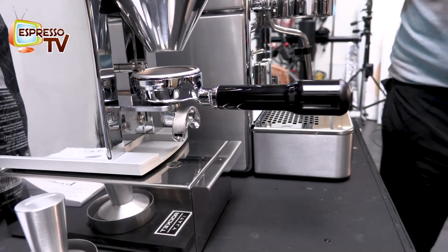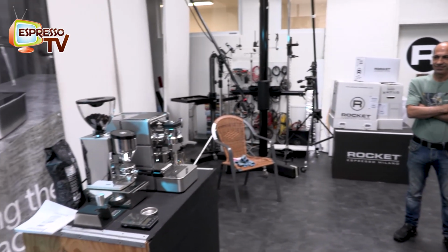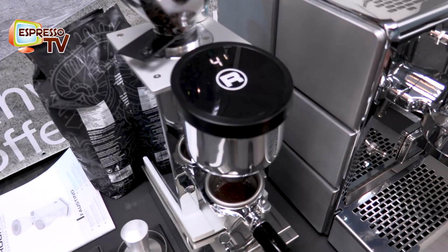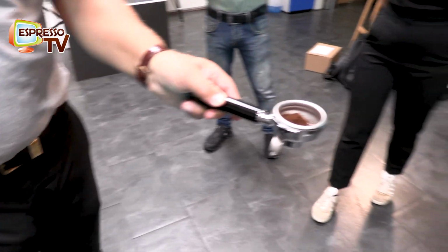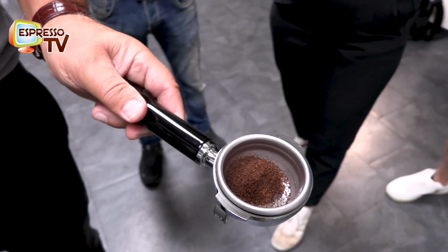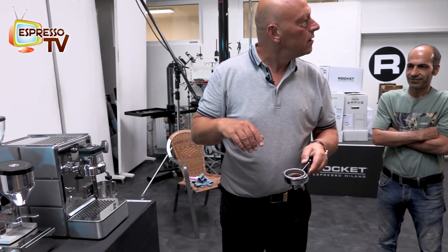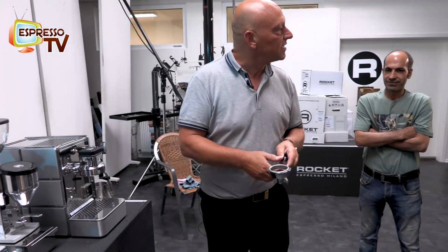But still, we have no clue about the grinding degree, whether it's coarse or fine or how to deal with it. So this is why we start in manual mode, okay? And then I stop and we see already it's too coarse. Absolutely. So here, please everybody look. This is too coarse, okay? So now when there are beans inside and we turn towards fine, the motor needs to run. Otherwise there is the danger that the burrs block, like on a bicycle, when you change the gear, it's better to change it when the bicycle moves.